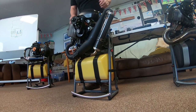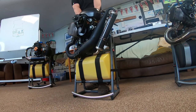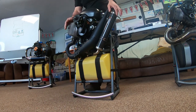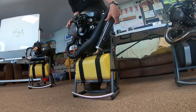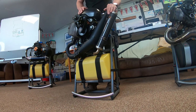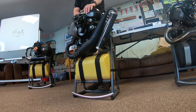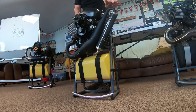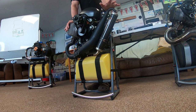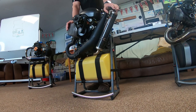And when I mean hands-on, I mean this sort of hands-on. Engine rubbers will not present a split or crack to you - or a hidden one - unless you stretch it and have a look. So you need to stand on the frame and pull it and inspect the rubbers. Same with the exhaust - I'm putting pressure on things because if there is a hidden crack or it was waiting to break, I want it to break now. That hidden problem will finally present itself; if you don't look for it, it will tell you when it's ready - which is typically when you're using it.